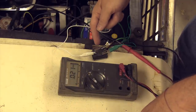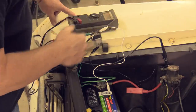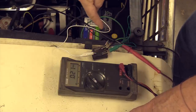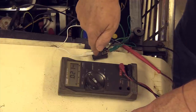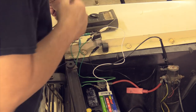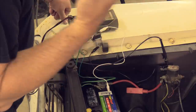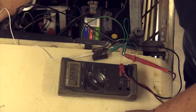I'm going to do a hot test — not a cold test. I prefer to do it with the same kind of stress load it would see if it was in operation. I have grounded the actual strap that mounts the relay to a ground point on the chassis, just like it would be if it was in the car. This has to be grounded in order for the relay to work because that is actually your ground. I have my power lead hooked up on this green wire going to the positive side of the battery. I have the white wire hooked up to what the blue and yellow wire would be — which is going to be your horn button function. This green lead is going out to my voltmeter so I can see if I'm getting 12 volts to the horns, because they do require 12 volts and they are a very high amp draw item. Now I'm going to blow my horn by grounding this out, which is what happens in the system. We've got 12.43 volts — about what we had before, dropping a little voltage due to resistance. That tells us the relay is functioning fine. I'm not going to replace it because it ain't broke.